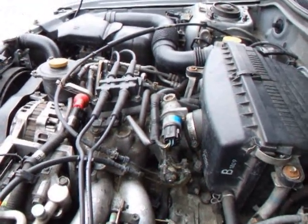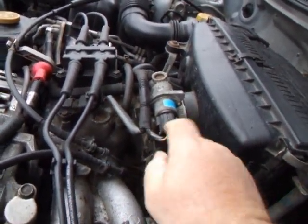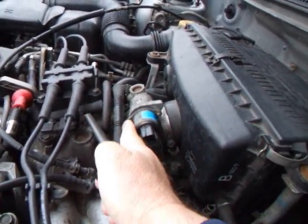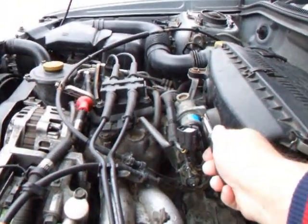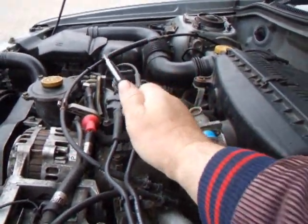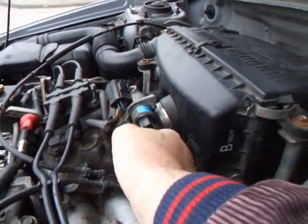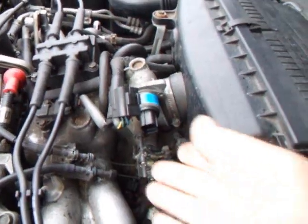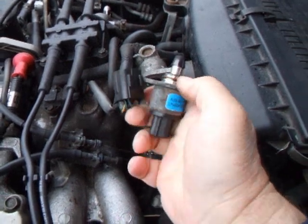However, I shall show the procedure. The first job is to remove this wire — you push in inside the clip and then pull it off. Then you have two Phillips screws, one there and one there. Try not to round them off. It's got a slot for a flat head too if you want. I'm going to put the camera down in case I drop the screws. Both screws are out. Now it's just a case of gently wriggling it out because it's got an O-ring on it which you see in there — a red one. This is clean.